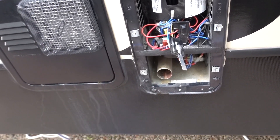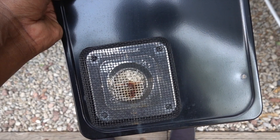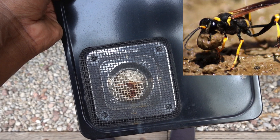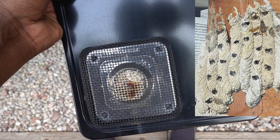Part of the reason I don't have a lot of maintenance to do is because I put a cover over my exhaust. I have a picture here of a mud dauber. These love the smell of propane and they do make nests in your appliances that use propane — your refrigerator, your furnace, your water heater. Be sure to put covers over these so they can't get inside. Because if they make a nest in there, it will be a lot more work for you to clean out, and it's really hard to do.